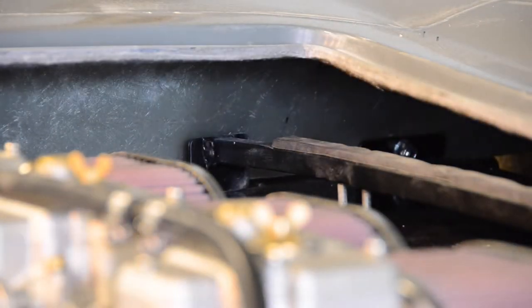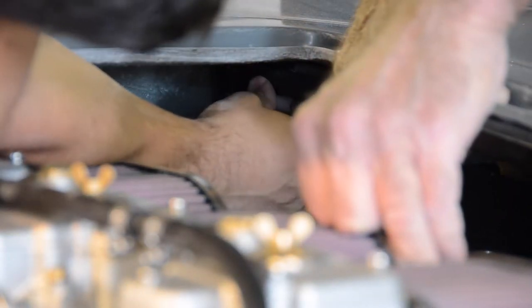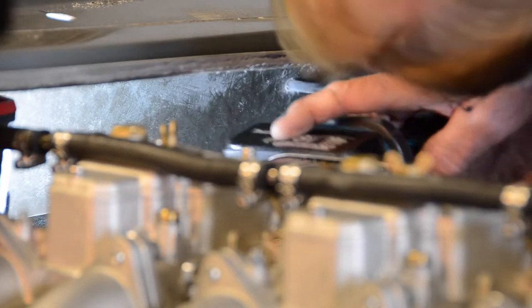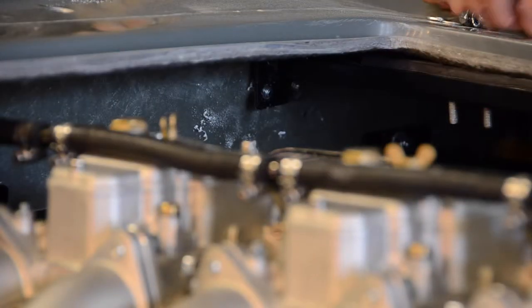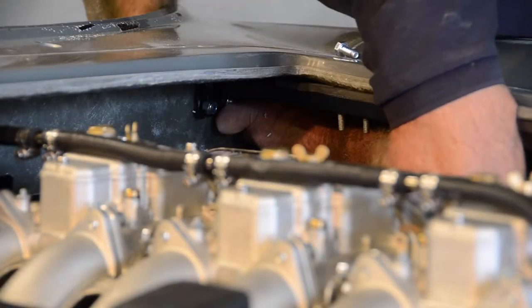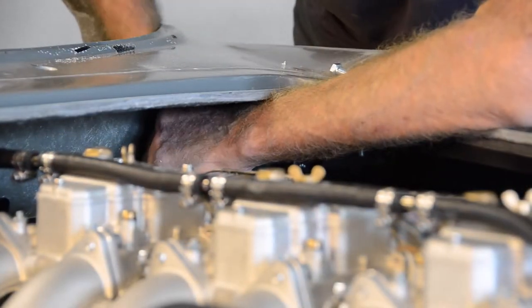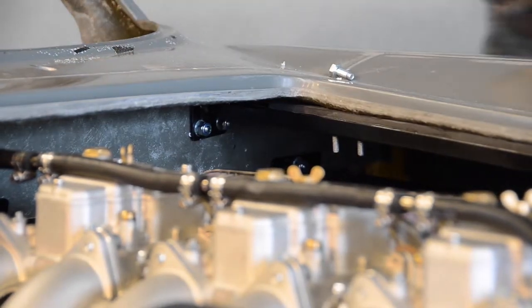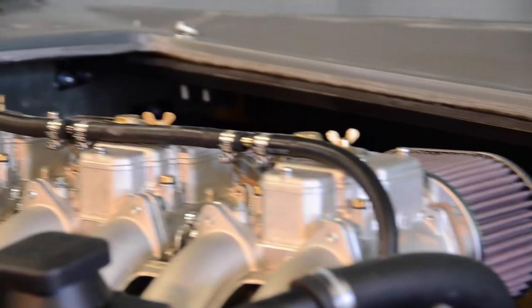With the bottom end of our wing rail now in place, we now need to hold the wing rail in its final position, lifting the middle of the wing rail up slightly and mark the position of the top of the wing rail bracket onto the body mounting panel in preparation for drilling. We can now drill the two required bolt holes and secure the top of the wing rail in position with the nuts, bolts and washers provided. Once again, it's advisable to use an extra pair of hands at this stage. This process can also be repeated for the second of our wing support rails.